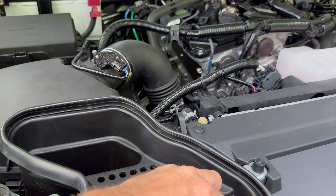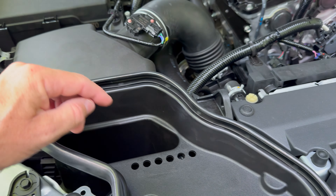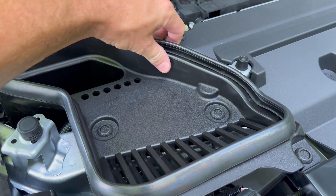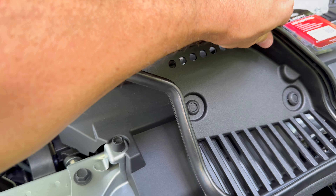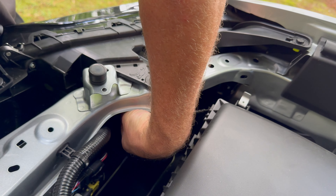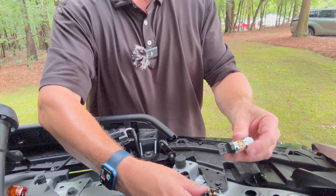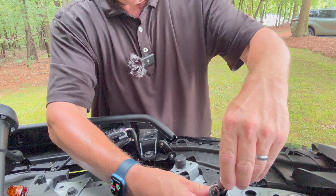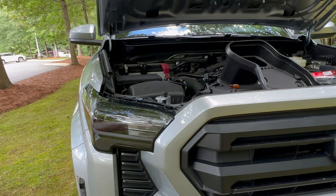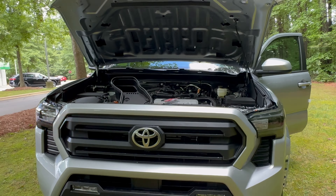Next, we've got to pop this piece out here — push, push, push, push, and remove. Set it off to the side. Going to take the light over here and turn it counterclockwise; the bulb pops out. Take our cord — remember, it's polarity sensitive — we'll try it this way and see if it works. It's 3:24, and I have bright LEDs on both sides.